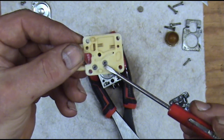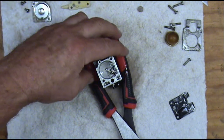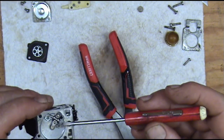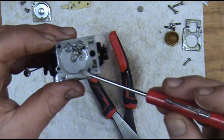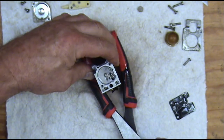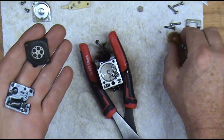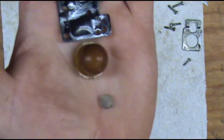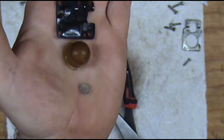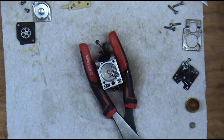These are little bitty check valves — they're very fragile. If you put an air nozzle right up to that and blow it, you'll ruin it. Same thing with this carburetor — there's actually a check nozzle right down in the bottom of this metering area, and you don't want to damage that. It's okay to blow it off, but just don't put a lot of high pressure in those little bitty holes. These two diaphragms, this primer, this screen, and this fuel line — those are really our problem.